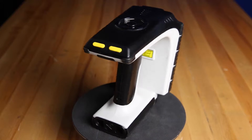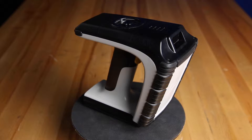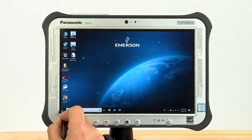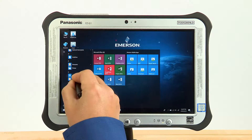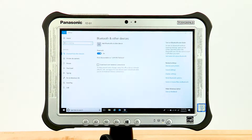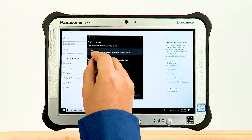The reader will need to be connected to the computer using the Windows standard add Bluetooth device process prior to using it with Asset Connect. To do this, from the start menu select Settings. Then in the settings window select Devices. From inside the devices window, be sure the Bluetooth and other device submenu is selected. Then click on the add Bluetooth or other device button. Make sure that Bluetooth is turned on and select Bluetooth from this window.